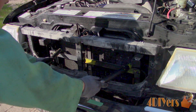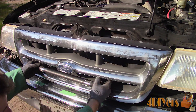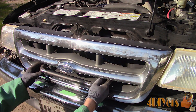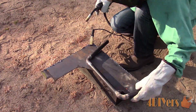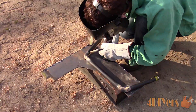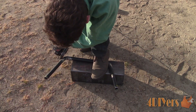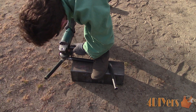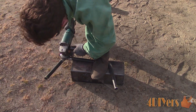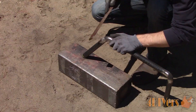Test fitting with the grill installed — I want this bracket to be as close as possible to the grill once done. The tubing can now be solid welded after everything is verified to be correct. Unfortunately the tubing can be a little tricky due to the curvature of the surface so you can't run a continuous bead. To smooth out those welds I'm using an angle grinder with a flap wheel — take your time, don't remove too much material, and if you have any low pockets more welding can always be done to fill up those low areas and regrind again. This will knock down the high areas leaving a level surface — start out with a coarse file and then finish up with a finer file. Here are those low areas which will need to be filled and smoothed out.